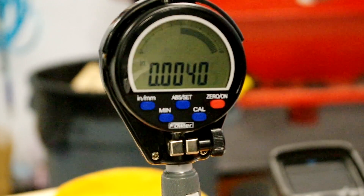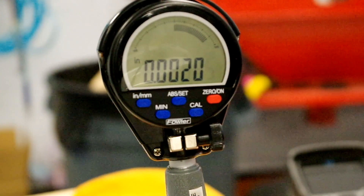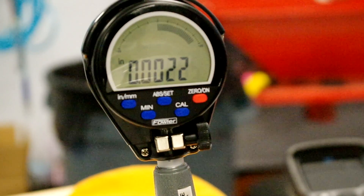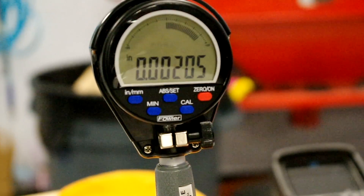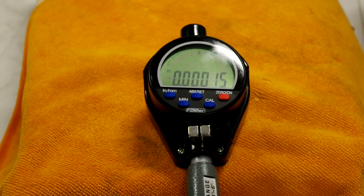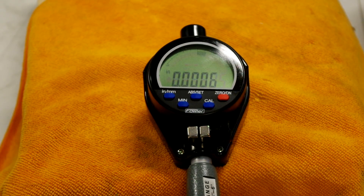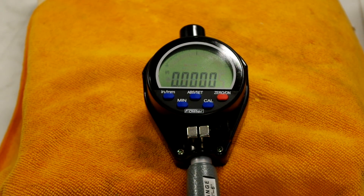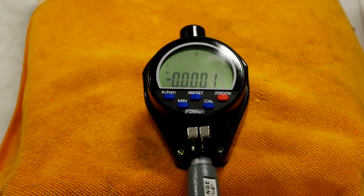Going back to the center — as you rotate this you can slowly find the minimum: 21, 20, so 1.9 thousandths clearance on this rod bearing. After measurements like that, I put it back in the caliper set to 4685 to make sure it hasn't gone out of calibration. Looking again for the minimum — sure enough, right at zero. Just double-checking that the bore gauge calibration hasn't changed relative to the caliper. So we have a good estimate of the bearing clearances for that rod and journal, and I'll repeat this for each rod with before-and-after calibration checks.